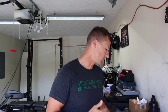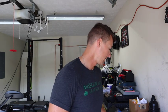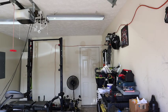So before we get into that though, I'm going to go over some of the common tools you're going to need. So a half inch and then a T27. T27 will take off the windshield and the fairing, and then the half inch will take off the lights, which you need to do to get down to the inner fairing stuff. And then you're also going to need a 5/32 Allen key. This will allow you to get in and take off the inner cover right underneath the lock. Can't remember the real name of it. But yeah, that's pretty much all it's going to be.